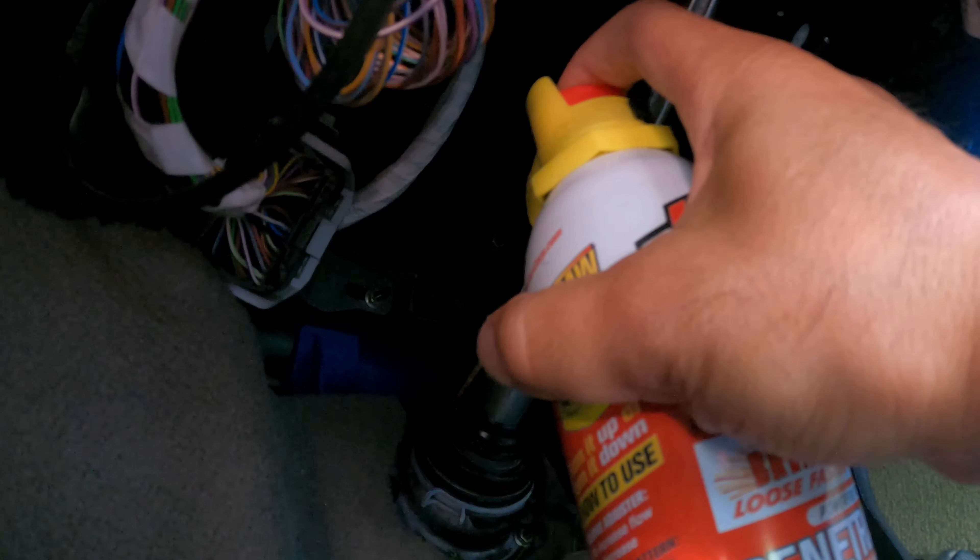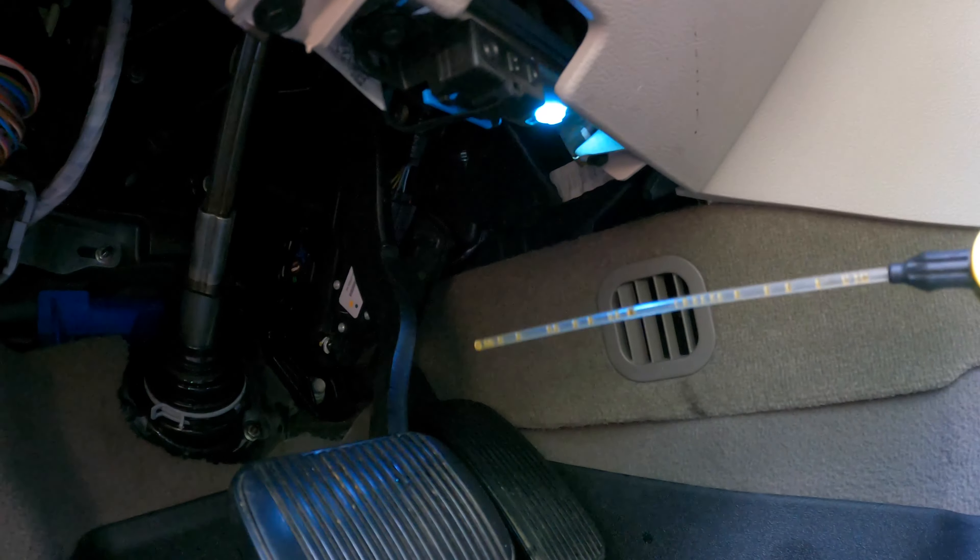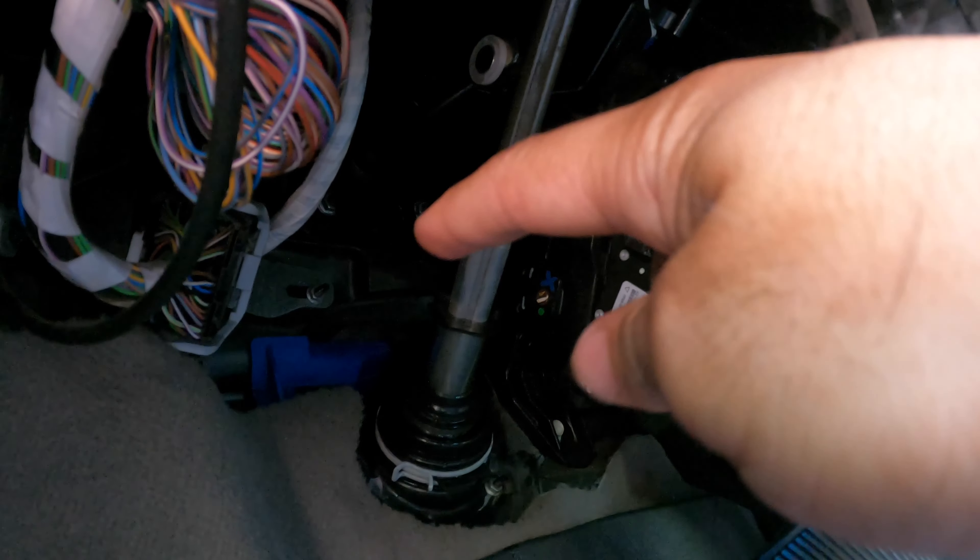And I mean a little bit — you don't want to over-spray either. So I applied the lubricant. The bottle looks like this, and I got it on my brake pedal. You want to spray at the top so when you spray just a little bit, it'll drip down and around the bushing.